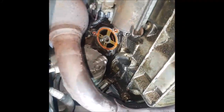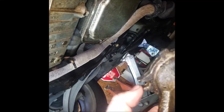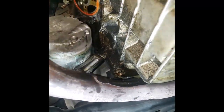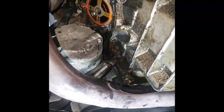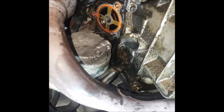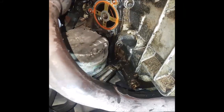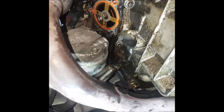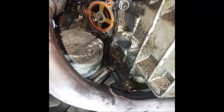So I've got the housing off. Here's the housing — it's got three bolts and it's got that slot right here by the AC compressor. I still had to take the AC compressor loose a little bit. I pulled the serpentine belt and loosened the compressor. I didn't take it down all the way because these bolts were extremely tight and it was trying to round that bolt head off, and I didn't want to do that. If you run into that, just take the serpentine belt off and loosen your AC compressor enough to get behind there with a good box end.